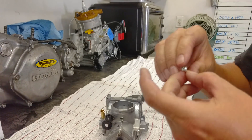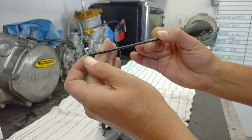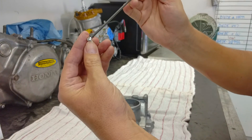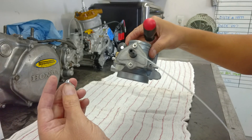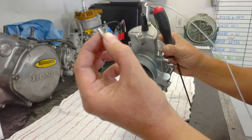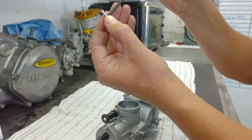The other thing we see at the track is people replace the top screws with a regular Allen or regular screw, but they have to be machined from the bottom of the shoulder about a quarter of an inch down. Because on the carburetor, the cap and the body are both threaded. So if the screw is not machined all the way down, you'll get a cross-thread between the cap and the body, and one of those is going to lose its threads. The screw is threaded through the cap to keep it captive, which is why that part of the bolt has to be machined down to clear the threads in the cap.